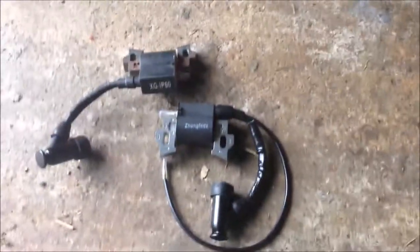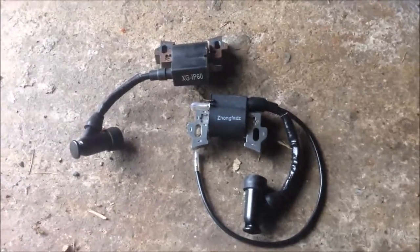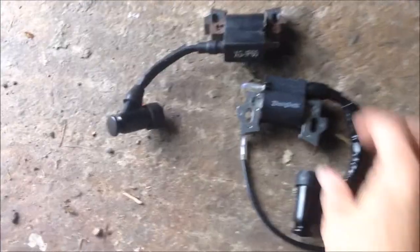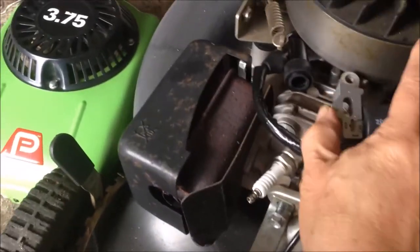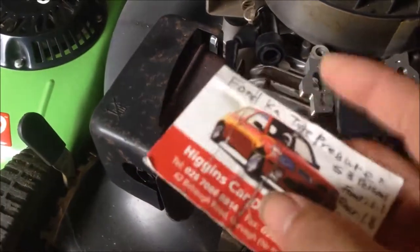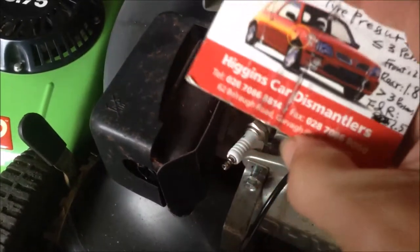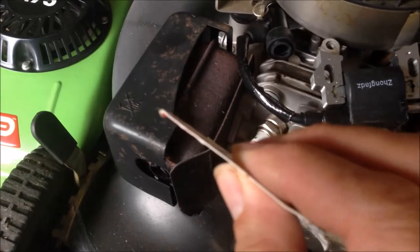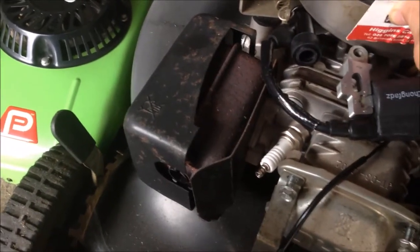I think they're very similar, I will try to see if they're okay. To install, we just put it over there, and the gap between this and this rotor should be about 0.3 millimeter — 0.25 millimeter. I think this card is about 0.3, so we're going to use the card to set the gap.